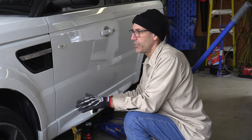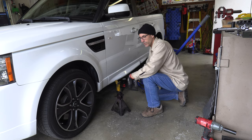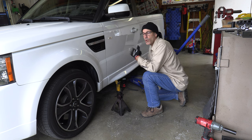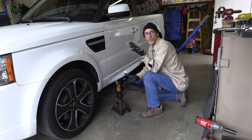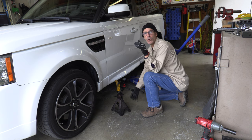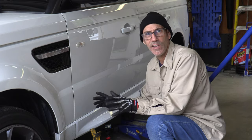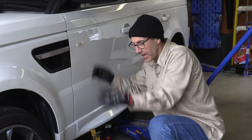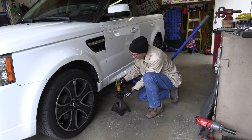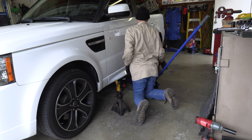There's a bit of confusion about what to do with the air springs at all four corners. The manual says to put it in extended mode before you jack it, but I've done it all three ways - lowered with the airbags dumped, in standard height, and in extended mode. When you lift with the airbags full in extended mode you actually have to lift the vehicle even higher because it pushes the suspension out. I prefer to have this thing only as high as it needs to be.